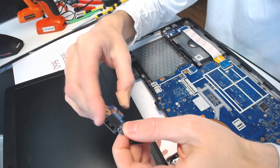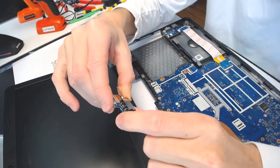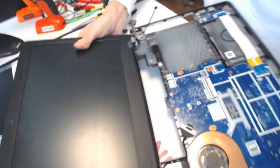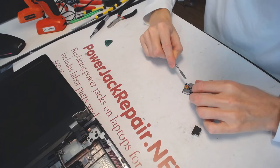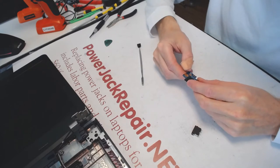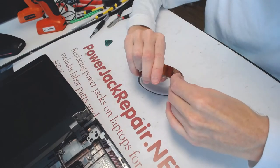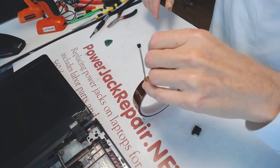So what I'm gonna do is I will insulate this area right here with the Kapton tape. And the Kapton tape, I apologize. Yeah, so the Kapton tape should keep the nearby component, which is this light right here and this connection right there, from being overheated. And you got also a few components right here on the bottom. So the Kapton tape looks something like that. So what I'm doing is, this is small board, so it's gonna take a lot of heat.